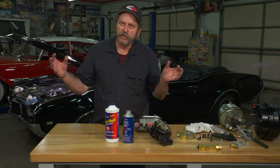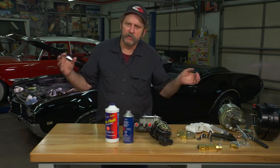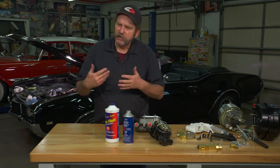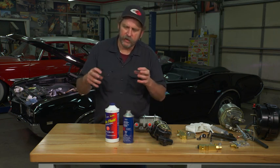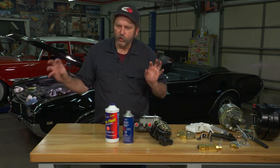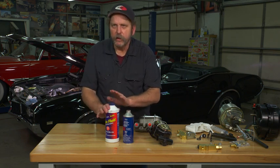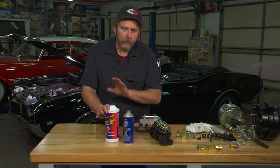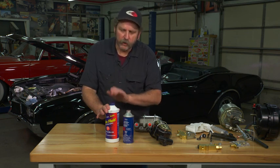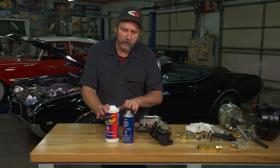However, that fluid is a lot more compressible. When you're actually applying the brakes, the fluid has some compression to it, and it's not compatible with water. The water tends to pool in the brake lines and actually cause rust or corrosion pockets within the brake system. Most aftermarket brake manufacturers won't honor their warranties if you use a DOT 5 fluid. So if you're putting in brake or performance upgrades, you really want to consider using DOT 3 or DOT 4.